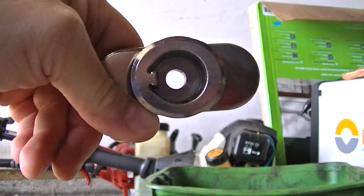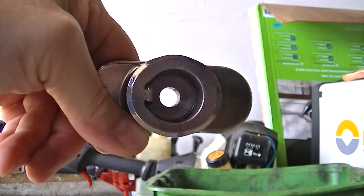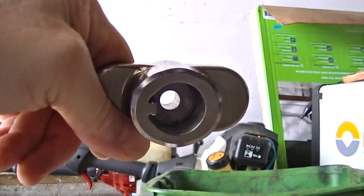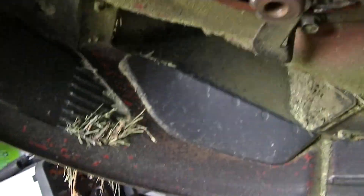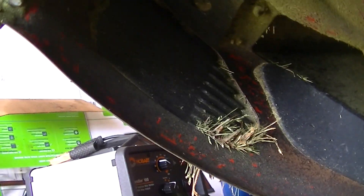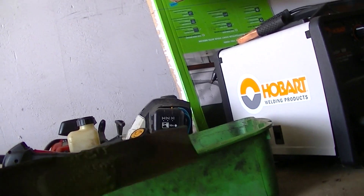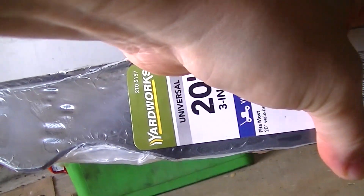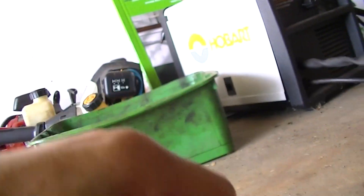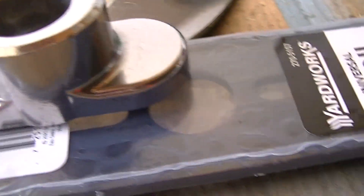If that built-in key feature is broken, your mower blade is going to spin free of the shaft. So I had to buy one of these new ones — about $18 online — which did increase the total cost. The last thing you want to check is how big is your deck. If you want to reuse the blade, the Troy-Built mower has a 21-inch blade, but unfortunately the personal pace here is a 20-inch deck. So I ended up buying one of these Yard Works blades at my local Menards — 20-inch blades. It has an adapter on it, and fortunately on the back side that'll adapt right up.